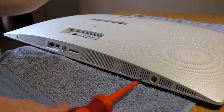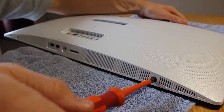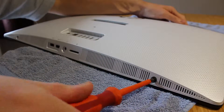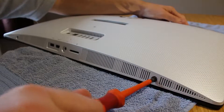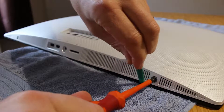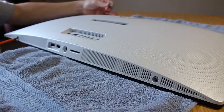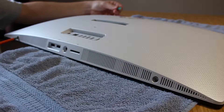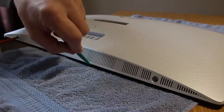Remove the white plastic protective case. There are two screws on the bottom — these aren't secured into anything, they are there purely to help you start the removal process. As you slightly turn them, you'll hear the tabs pop. You just turn the screws slightly and it lifts the cover away from the screen without having to pry around.